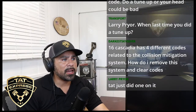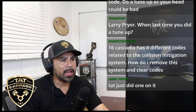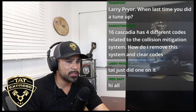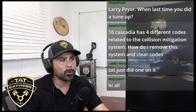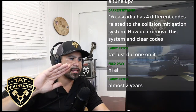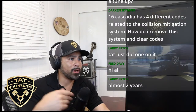I've got a check engine light on, from GS. When I hit the pedal, nothing happens. If it's going to be a throttle position light, that's maybe an electrical problem on your pedal. I would have to get some more information. If it's from the throttle body, if there are sections in that motor that are moving, the throttle body has a resistor in it. If there's a worn out section in that resistor, there could be a reason why you have an issue. So keep an eye on that.